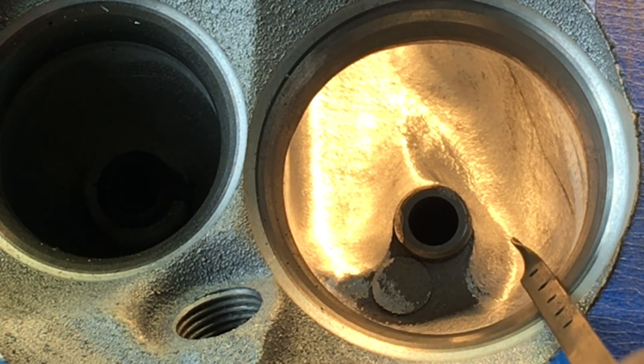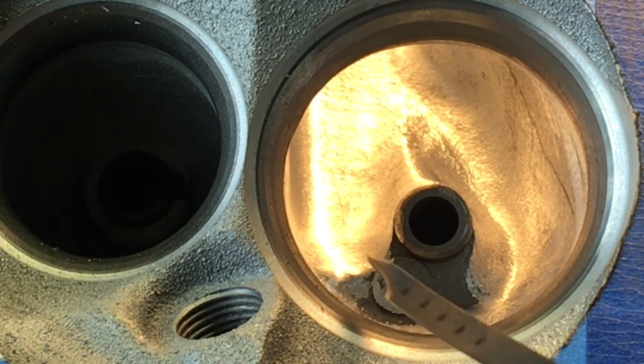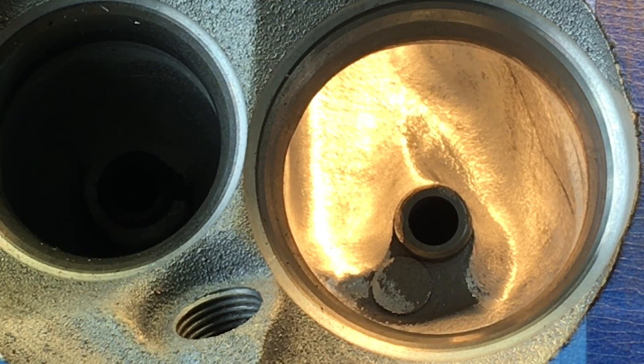This has a nice transition to get in. I just wanted you guys to see the design and the reasoning why I do the valve guide boss in this shape on these 215cc heads. The entire port has been textured, but I'm going to go back through probably with some rough 60-grit sanding rolls and just hit a few areas to clean up some of the casting lines a little bit more. For the most part the intake port work is done — it's just what I call the final pretty work, trying to get everything as smooth and clean looking as it can be. Then we'll switch over and start knocking out those exhaust ports.